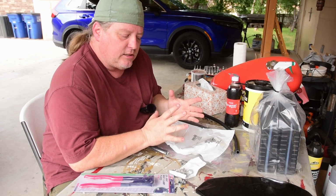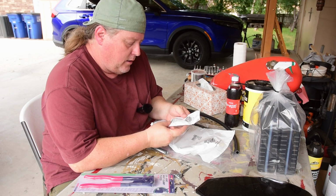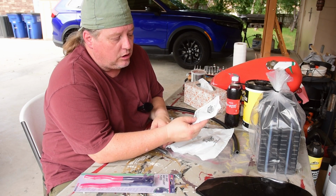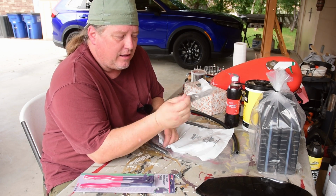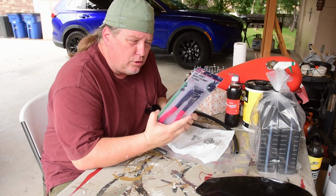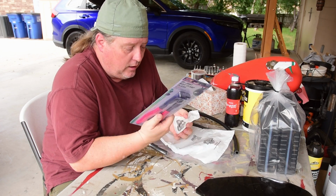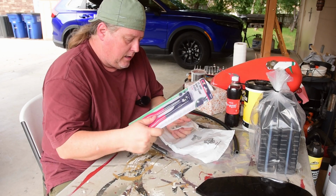Now, Harley-Davidson installs these with, what do they call these? Well, the part is drain hose clamps. I got them direct from Harley-Davidson. They're the kind that are one-time use where you pinch them, and they require a special tool to use. I had to go to Harbor Freight to buy this. It was $12. It's its only purpose.